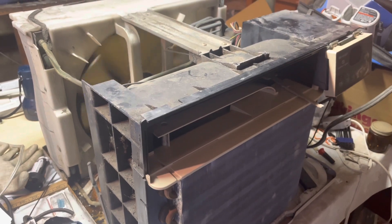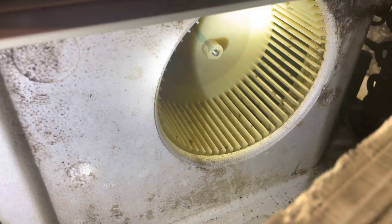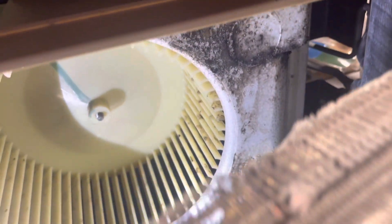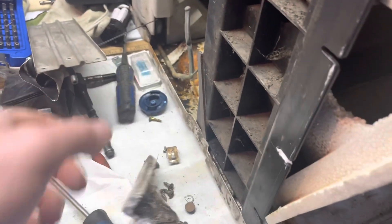This is going to be fun. Alright, I got the nut off the blower wheel and it's free. That nut is reverse thread — it was pretty loose, actually. So now I'm trying to take this piece of styrofoam out. There was a screw in it, right up there where you can see where that hole is. And there's still some stuff on there that needs to be cleaned off, so I'm going to do that while I have it out. This is a pain in the ass. You can see I actually broke part of the styrofoam. I have the piece right here so I'll just glue it on. I didn't break it trying to pull this blower wheel out — I just broke it trying to pull a piece of styrofoam out because I didn't see there was a screw over there.